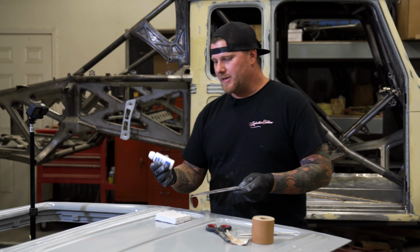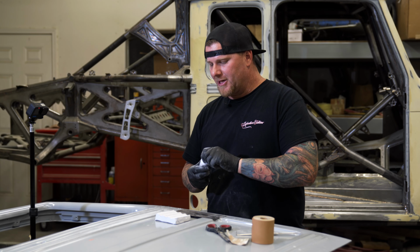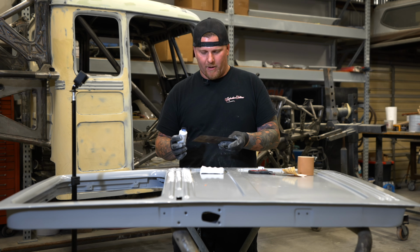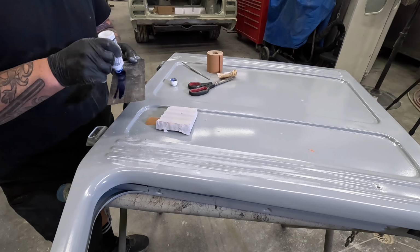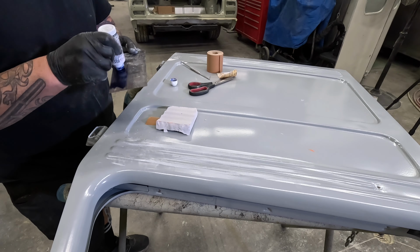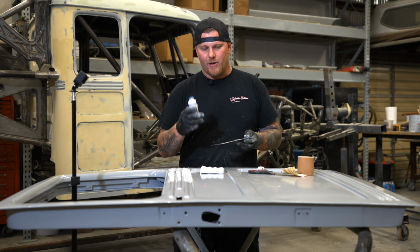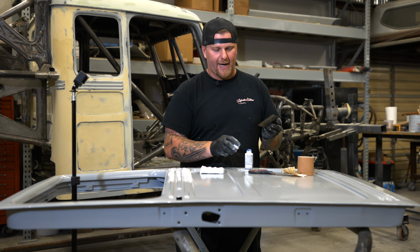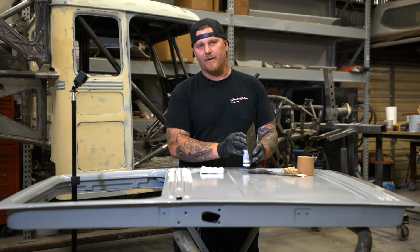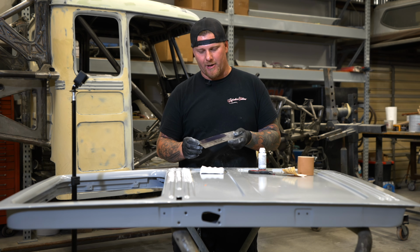So that's what we're gonna be using here. Dykem is the brand. It's for actually laying out stuff with molds and machining. And what we're gonna do is just paint this onto a small area that we're gonna use. Now, if you were doing this for a Pullmax or any other reciprocating hammer, you would be spraying this onto a thick, solid piece of stock that you could then mill down and weld into the shanks on your Pullmax.